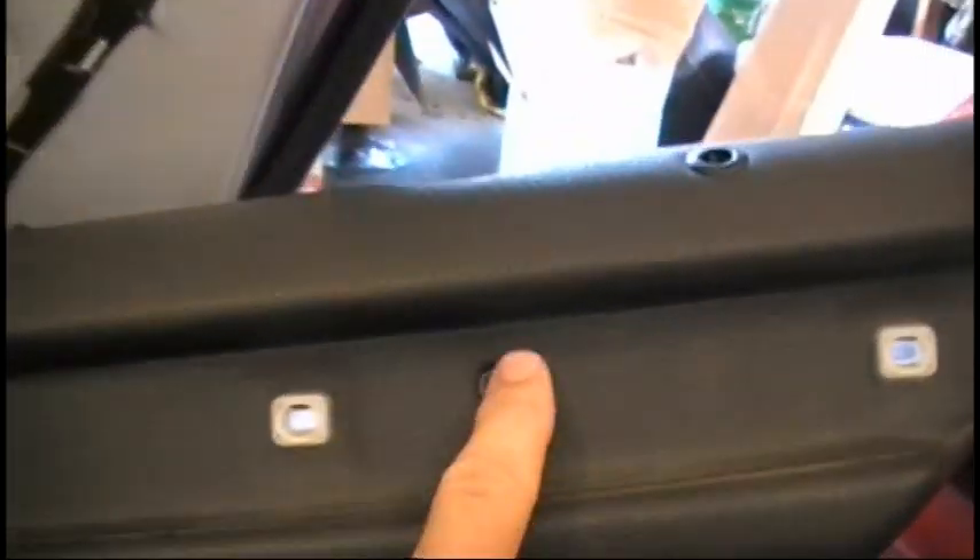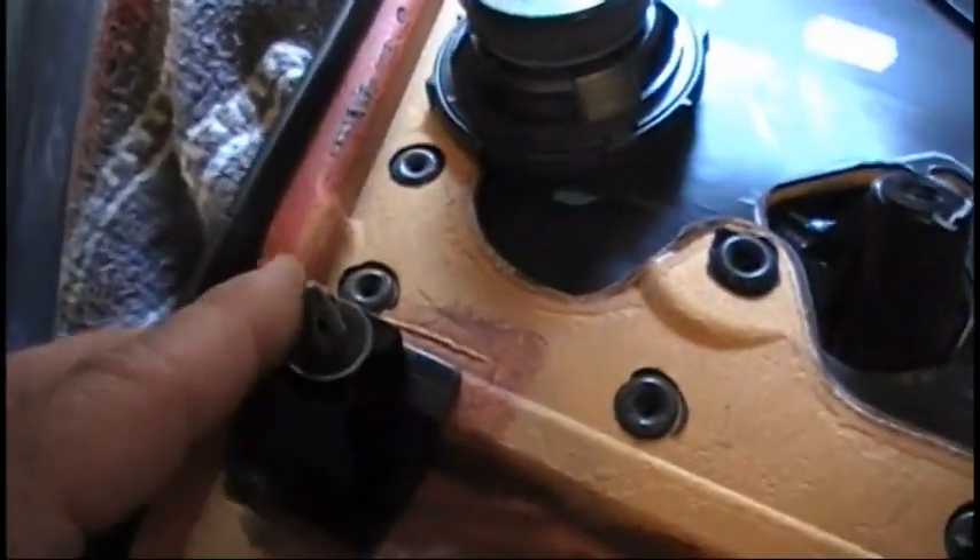Basically you just pull this door skin off. You pull off the trim piece that's here — this wood trim piece. You pop this off and there's two screws, one here and one here. Once you get those out, you need to remove — in my case I have power windows. If you don't have power windows there should be a little cover here. You pull this little power window switch out. It's kind of difficult — you have to maneuver it out between the plastic here. Once you get it out there's another screw right in there. You get that screw out and then all that's left is snaps — across the top and down along the sides. It just pops out with these Christmas tree type snap things. Once you pop that out, just set it aside.